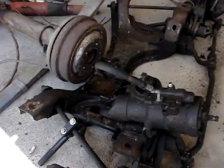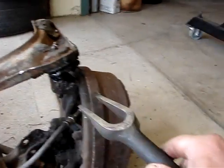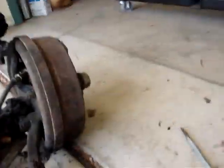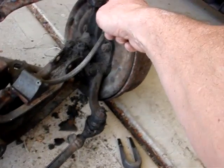These are the upper ball joints. Jim gave me one of his ball joint tools — it's supposed to go in there and knock this out. If this doesn't work, I've got some cheaper ones here but they split and start to get beat up. I've got a good Snap-on one here. You're going to have to pop these loose on each side — upper ball joint.